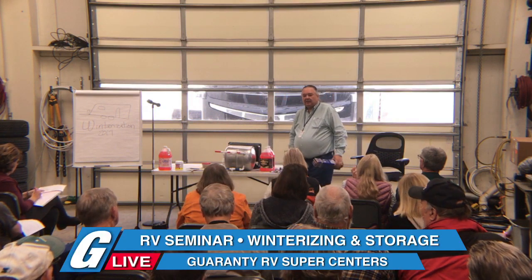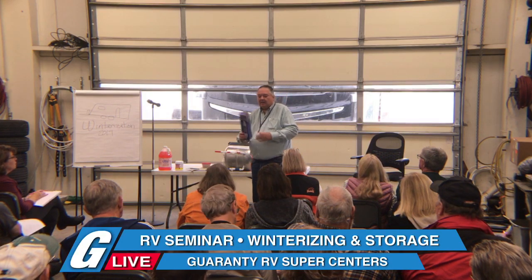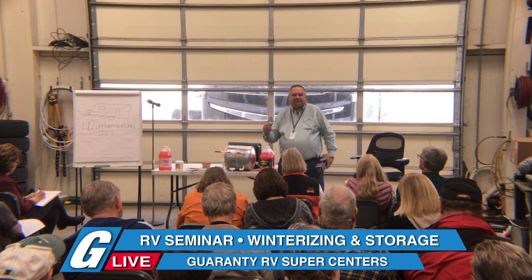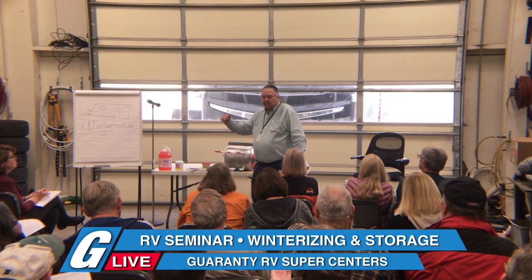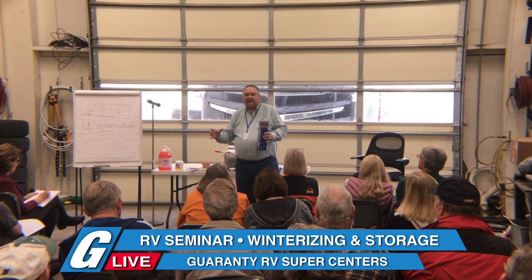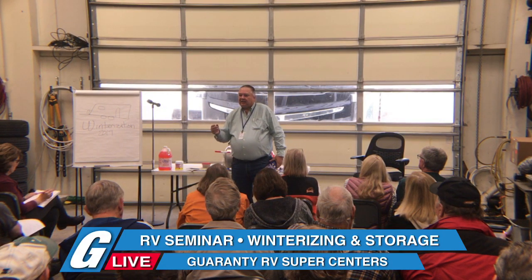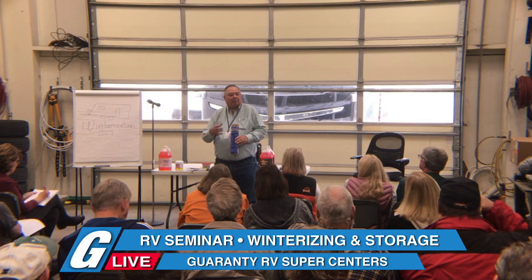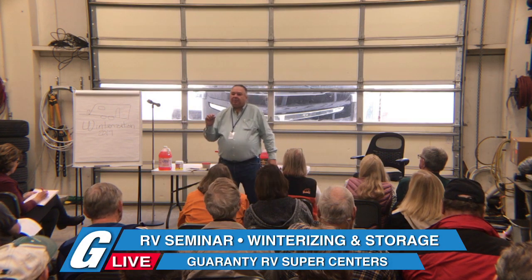Last thing before we start going through the system, unless you have a bunch of questions: filters. There's two kinds of filters. There is the kind that is a whole coach filter that you either put in your wet bay or near the fixture, the hose bin, the outside faucet where you hook up. A lot of people get the whole RV filter and it filters everything going in. These whole RV filters only filter out the chunks. They are not designed to get out the microbial and all of the other stuff, because the finer the filter, the faster it plugs up.